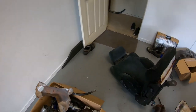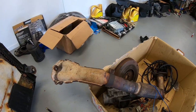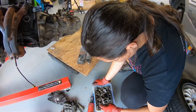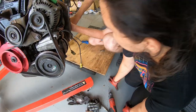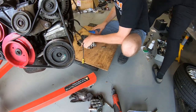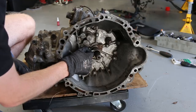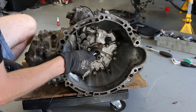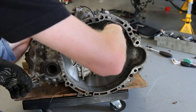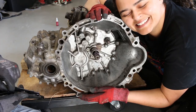Starter motor, where did the starter motor go? Found it! For those that tuned in last time, you may have noticed a few odd bits about the starter motor. The issue we discovered was that I had two motors, the original one from my automatic gearbox, and a blacktop one which accidentally was sent to me, I believe. We had a C52 starter delivered, however the electrical unit was damaged, so I needed to swap the part over with a geared unit from one of my other starter motors, but after that we were back in business.